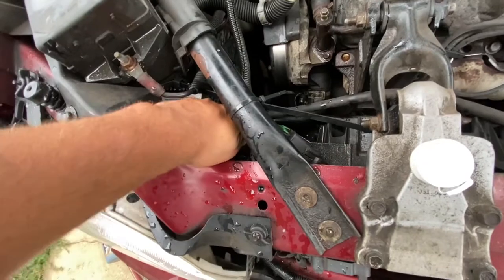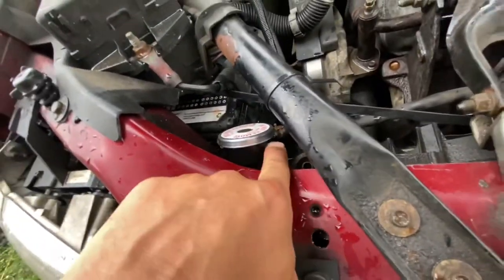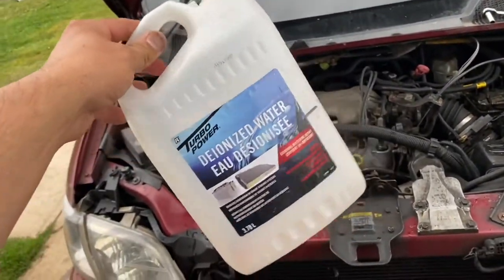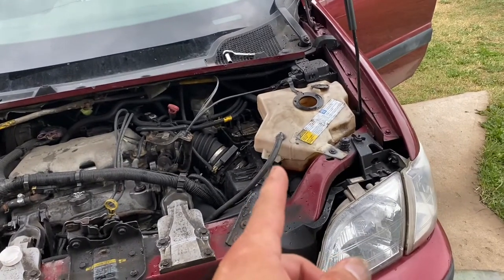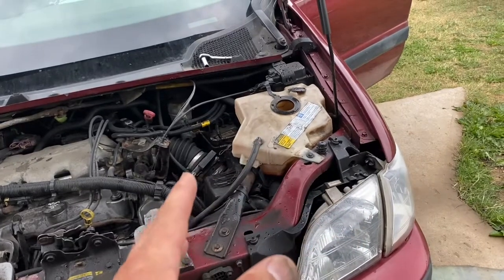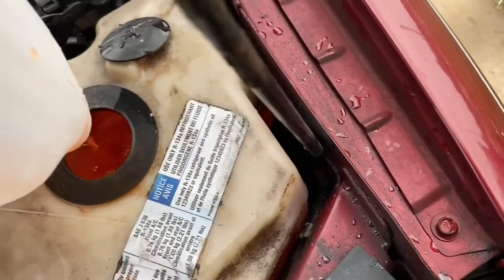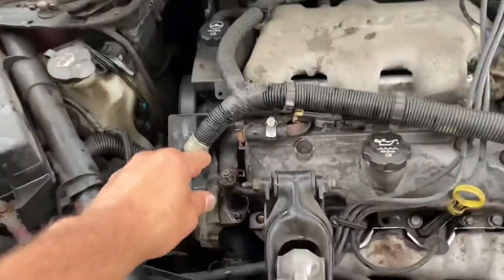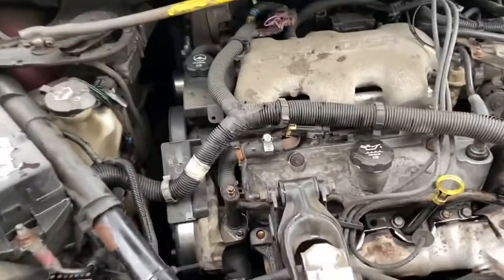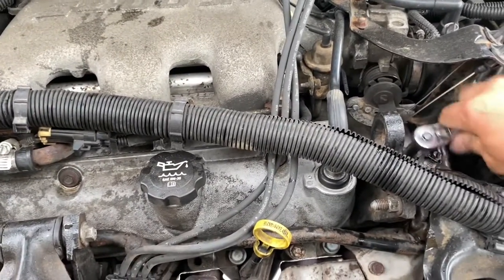I shut the motor off briefly to get the cap on all the way — you have to push it down and turn it all the way until it reaches the stops. We used about four liters from one full jug. Now we mix up some more antifreeze and fill the overflow reservoir — it should take about four liters but we're putting in about three liters for now. Close that up, then tighten the bleeders nice and tight with the 10mm — don't break them off, they don't need a lot of torque.